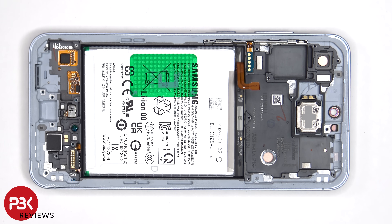There are also rubber gaskets and mesh filters over the speaker opening on the frame, as well as the microphone openings. For anyone worried about accidentally puncturing the microphone by inserting the SIM ejector tool in the wrong hole, on this phone you don't need to worry, since both the filters and the microphones are seated above the hole, so they won't get damaged.